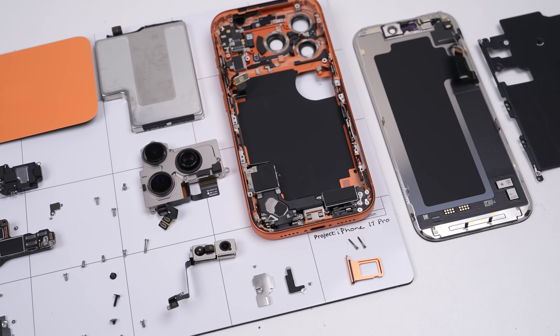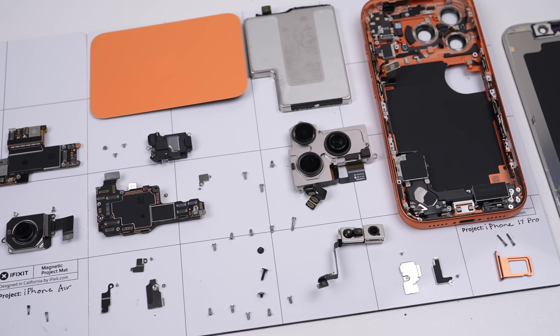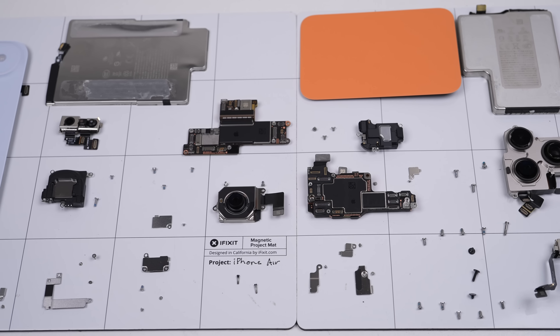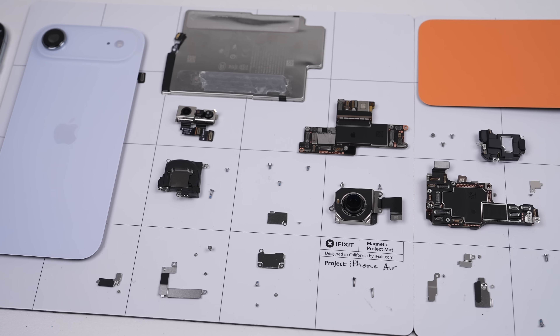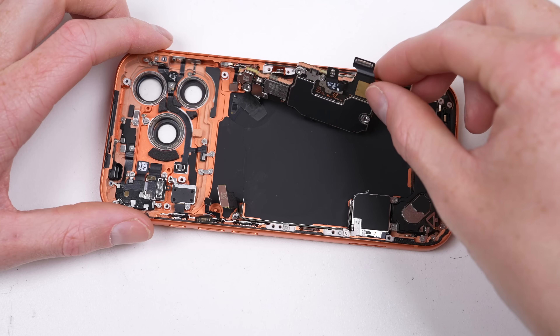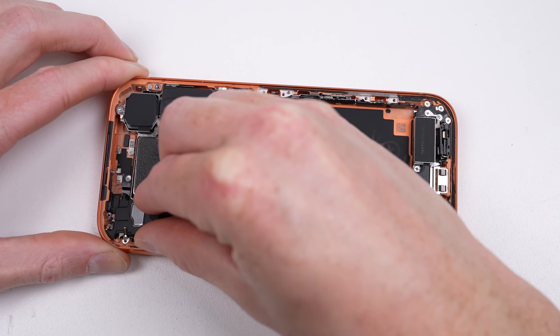With that, we've now completely disassembled the iPhone Air and iPhone 17 Pro. The Pro model has gained a vapor chamber, lots of extra Torx screws, bigger cameras, a battery that can be removed with screws, and a small glass panel that can be easily replaced. However, the redesign has foregone the ability to replace the battery without having to remove the display. The Air, Apple's new ultra-thin phone, is remarkably jam-packed. The battery is larger than I expected and can be removed with electricity — but watch out for that Taptic engine cable connecting to the charge port. It breaks easy.